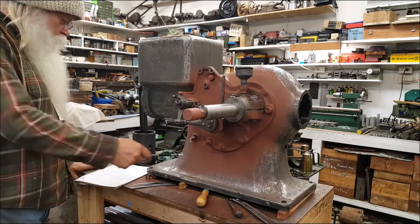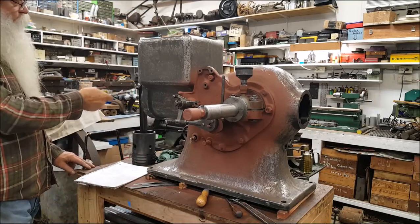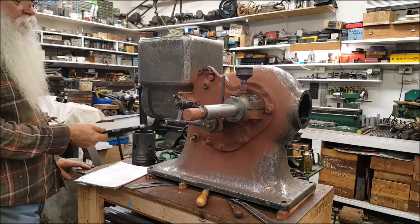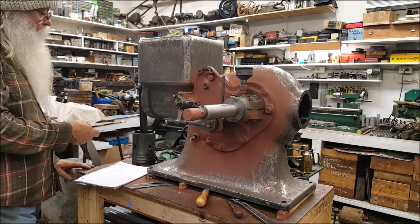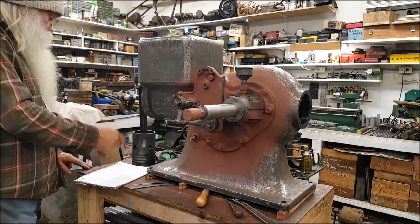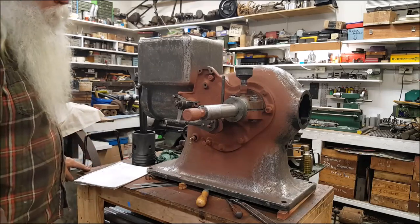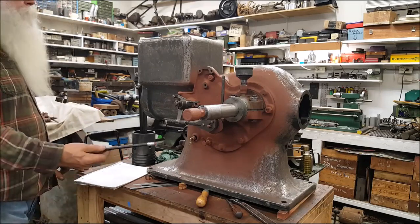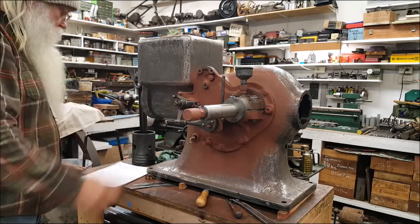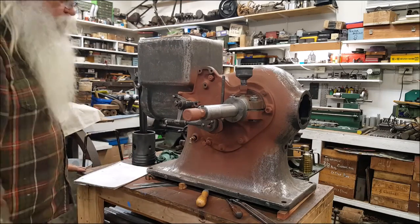So we still got to get a fuel pump. We still have to get an oiler. We still have to rebuild the mixer. I think it's going to need all 3 siphons, 3 needle valves, complete rebuild, compensating valve, an exhaust system. I'm going to use just piping, some elbows and a straight pipe. It'll add a cost to it. Paint. A magneto came with the engine, if you remember, so we don't have the cost of the magneto. I have penciled in there what you think the total ending cost is going to be.